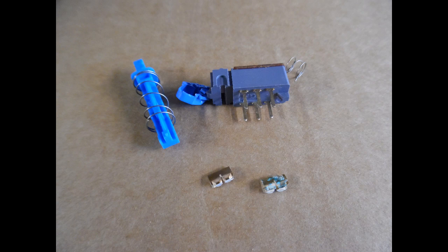Once I had good latching operation, I used the multimeter to verify the switching contacts on both sides — common to normally open and normally closed — and everything was working fine. Since the switch was disassembled, I also took the opportunity to clean it up and apply some DeOxit, operating it many times, which restored that missing channel on remote speaker selection.